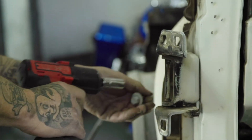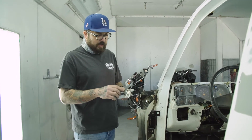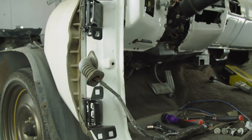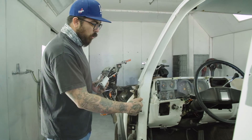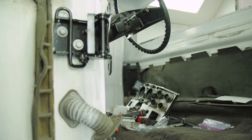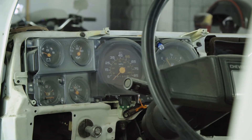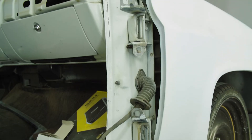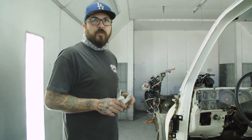When we were taking off the original door, I noticed that the hinge on this side was really loose — we had a bunch of bushings that were blown out, pins were loose — so we decided to upgrade to new door hinges. There's a bolt that goes behind the dash; you have to pull the dash apart to get to that, so just so everyone knows, you're going to have to do some work to get this hinge off. On the other side the hinge was pretty nice, so we decided to keep the stock hinges and hang the crash door on that side, then come back and hang the nicer door.